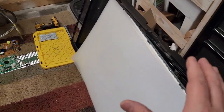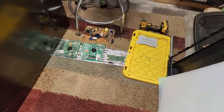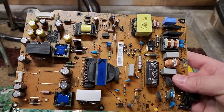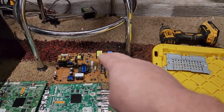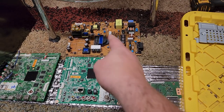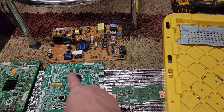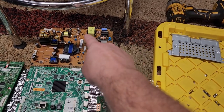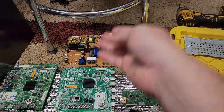You can see I have my TV in pieces — I had to lay it out like this so I could show you piece by piece what was going on. One of the first things I want to go over is the power board. My measurements on this power board were pretty spot on, except for the standby signal, which goes from the power board to your image processing board or display board, then to the power buttons and back. When you press the button, it tells the board everything's good, and then the signal turns on the power supply the rest of the way. You start with standby power and then go to full power.